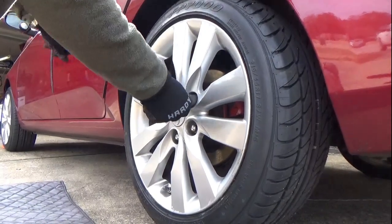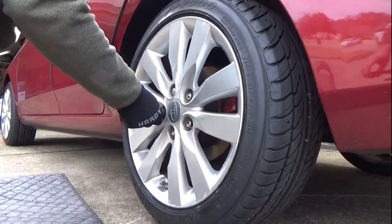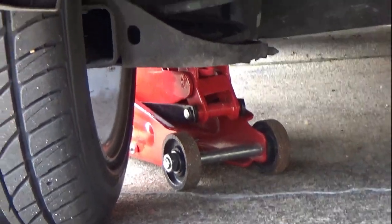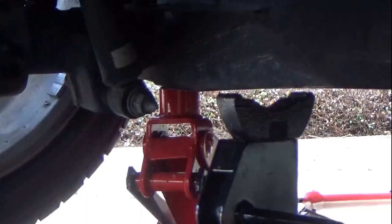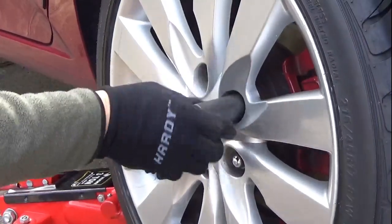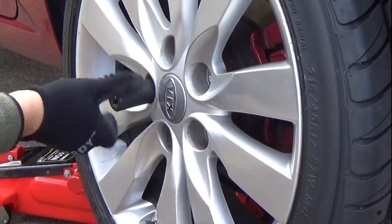Be sure to put down the wheel chocks before you get started. Always remember to break the torque on the lug nuts while the tire is still on the ground — you can use the car's lug wrench or a 21 millimeter socket. Then jack the car up and slide the jack stand where you want it. Always use a jack stand and never work under a vehicle held up by only a jack. This also lets you remove the jack afterwards so it's out of the way. Then finish taking off the lug nuts and remove the tire to gain access to the top strut bolt.